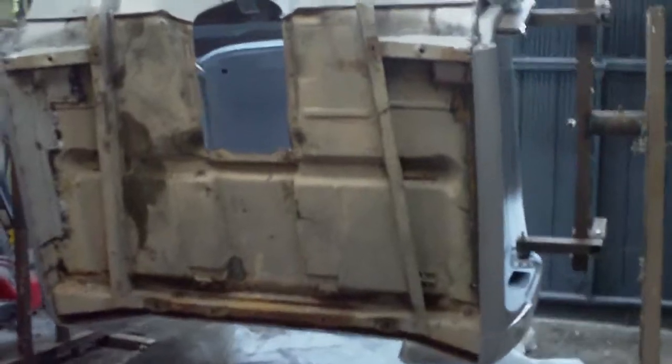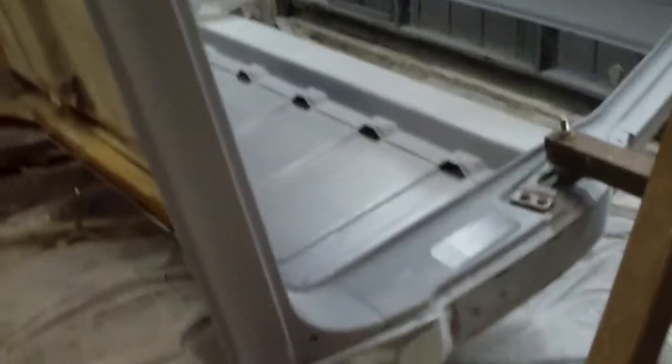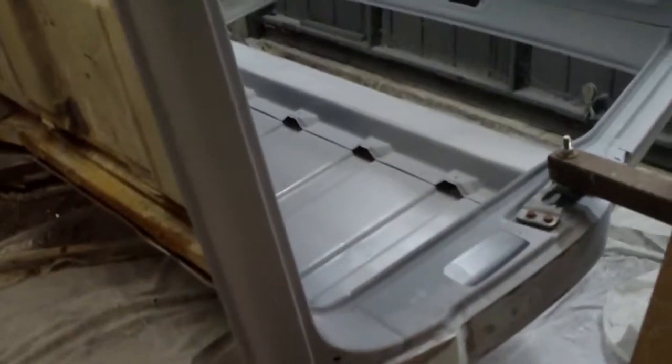This is rather weird looking, but there you go — that's the cab tilted almost 90 degrees. Not quite perfectly balanced here. I need to move the mounting point closer to where the center of gravity is, because obviously the firewall is the heaviest part of the cab. But anyway, I can actually do some work on the bottom here.